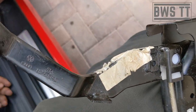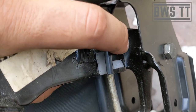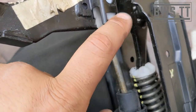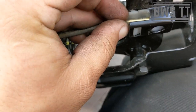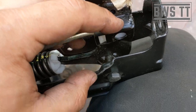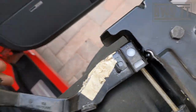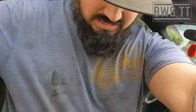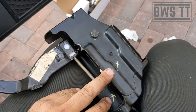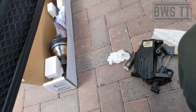There's usually a black clip that sits on here — just pry it off both sides. Then there's a white clip that you pry from both sides with a screwdriver, and it pulls out of this part here. Obviously we'll do that with the one on the car. Access does become a bit tricky, so slide the driver's seat all the way back. If you're bigger than me, you might want to take the seat out entirely for much better access.